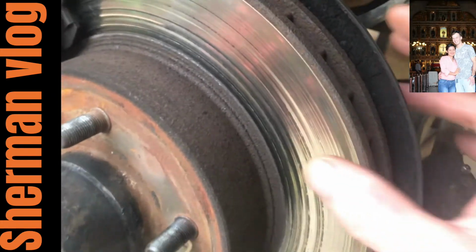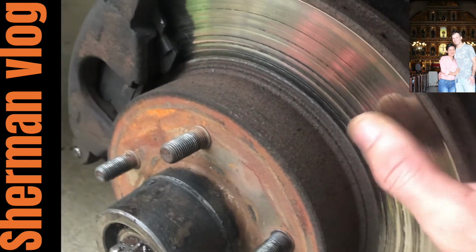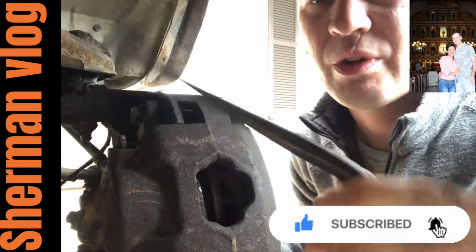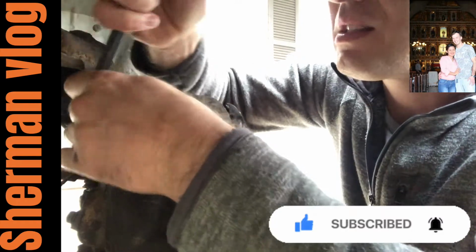All right, this is what I was gonna show you. You see, there's grooves in it so bad. It's time to replace them. All right, go ahead and get you a 3/8 Allen wrench like I have and break this loose, right?